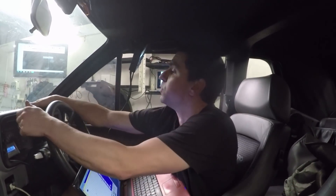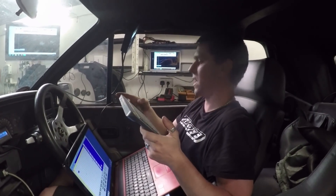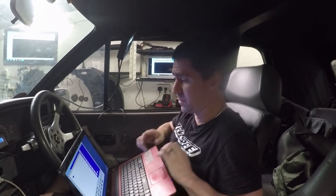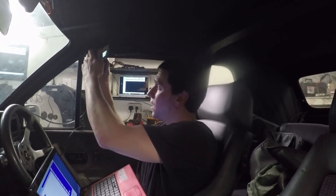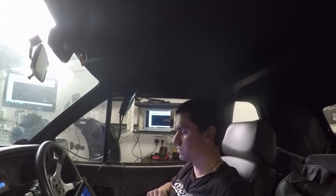We've tightened that wastegate nut all the way up — it's literally about to disappear inside the wastegate. So we can't get any more boost by adjusting the preload. Ollie came up with the idea of going to his unit and digging out a tee piece off a washer jet. We're going to tee into the top line and bleed some boost away that way. If we can get it over 10 PSI we'll be happy. We've also turned up the boost protection. We'll do a little run, keeping a close eye on the air-fuel ratios.